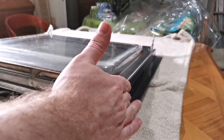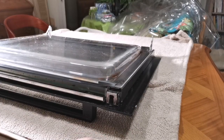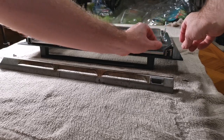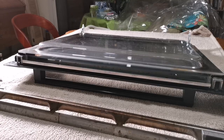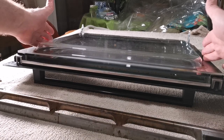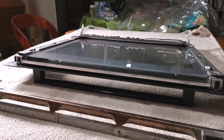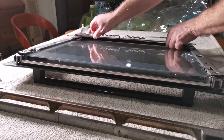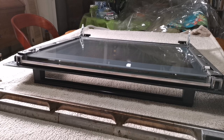That should let us just pull this piece off. The next step is to remove these rubber seals — one and two. Now, according to Bosch, this inner glass should just slide up easily, but because this one's broken you might have to be a bit more careful with it. Lift off the dead piece, slide up the broken piece, and it just comes out. It gives you a chance to clean it before we fit the new piece.